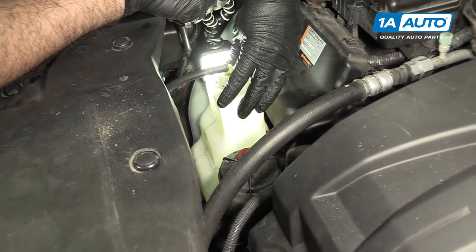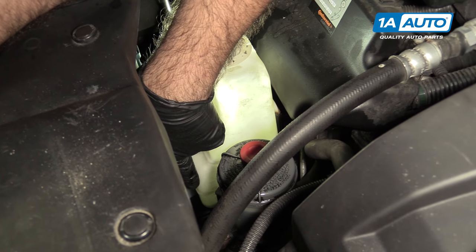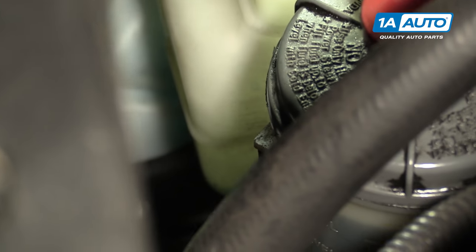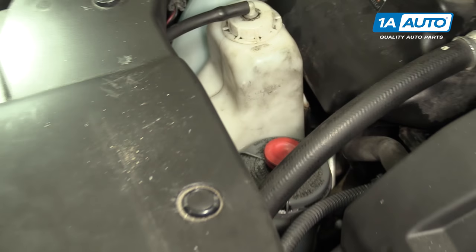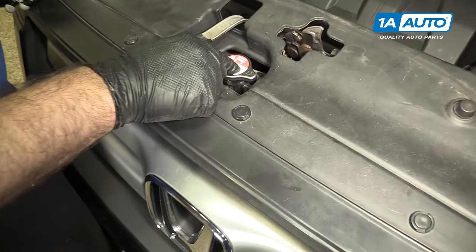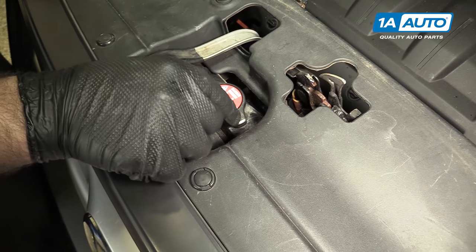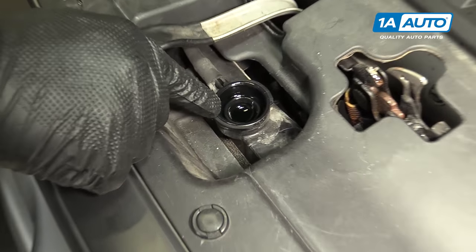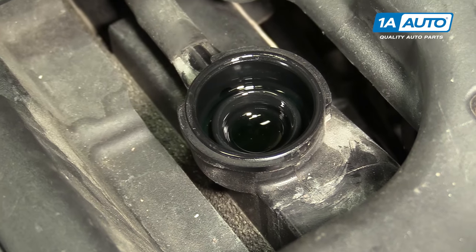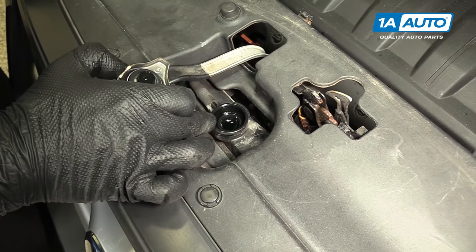This here is your coolant reservoir — your overflow reservoir. This also has a high and low mark. You'll often find the coolant is a little bit low; we should add some to bring it up to the low mark. It's not super crucial to have this totally filled up. What's more important is checking the radiator itself — always do this when the vehicle is cool, never after you've been driving. It even tells you this on the cap. When the vehicle is cool, you can open this cap, and your coolant should be right at the top of the radiator. If it's not, add coolant to bring it right up to the top.